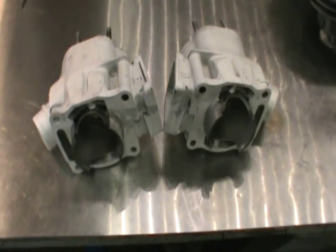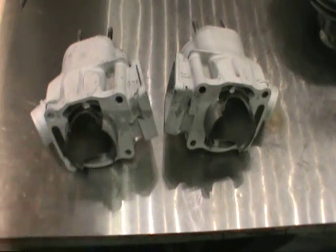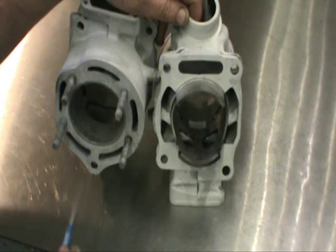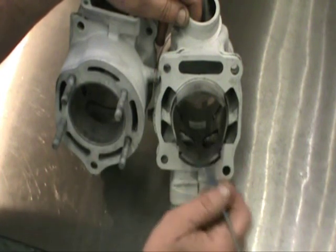We've got our cylinders out of the ultrasonic cleaner and I'm ready to paint them next. When you use these templates, the cylinder walls have to be very, very clean. That's the first thing you want to do. If you're putting a rag in, you still have to degrease them with something — get the cylinder wall free of any kind of oil and grease. Next thing I'm going to do is put the templates in here, get the Dykem on, lay them up, and start scratching some lines. My cameraman just showed up for this job, and he just happens to be the owner of these cylinders we're experimenting on today. So we're just going to take the Dykem and lay it all around the exhaust port and all around the intake port for now.